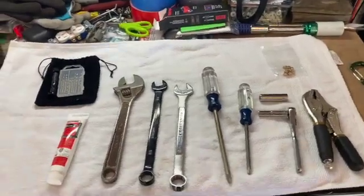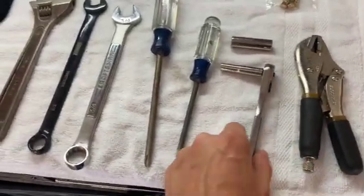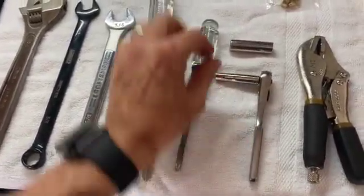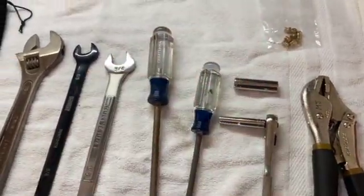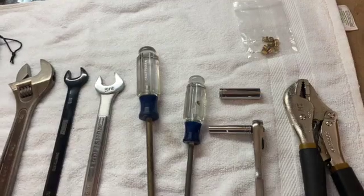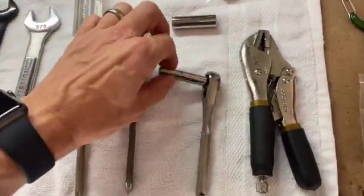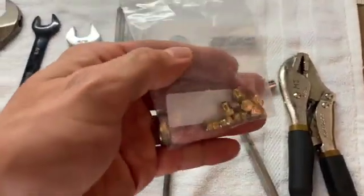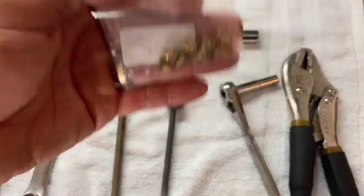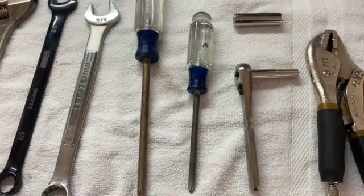These are some of the tools you're going to want to have. A set of vice grips, a 7mm socket, and also an 11mm. The 11mm is going to be used to get the manifold off of the cook box. The 7mm is what's going to be used for getting the orifices or the nozzles. These are the extras, the new ones. Get those off of the old manifold and replace them.